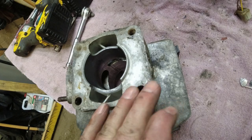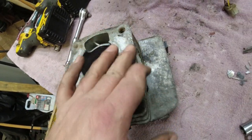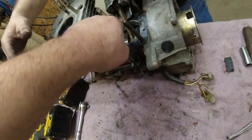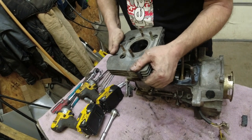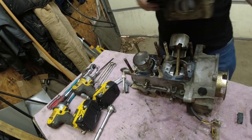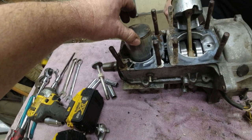it may still be salvageable. Yeah, the sealing surface. Yeah, it's still going to seal. We'll have to file that down, but we think it was this corrosion on those two studs that had it locked in so bad. Look at the other one. Dennis just lifts it off by hand. Look at that. And the other piston is not shattered.